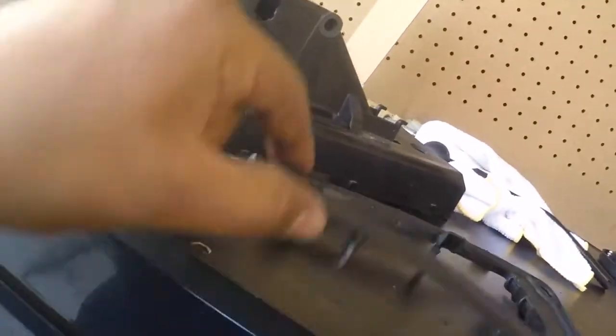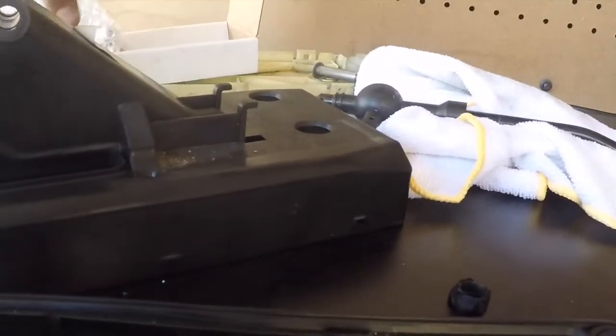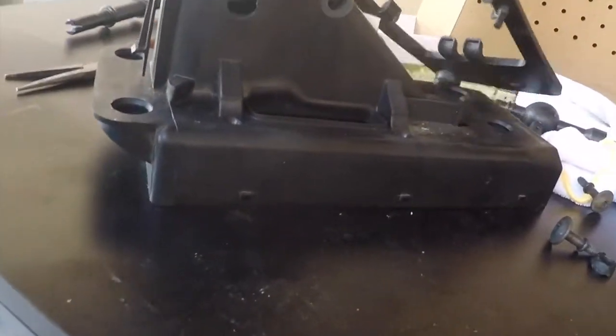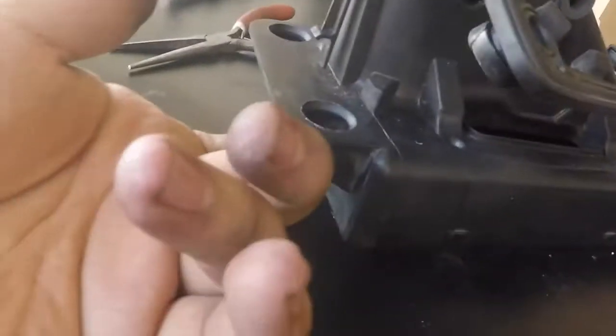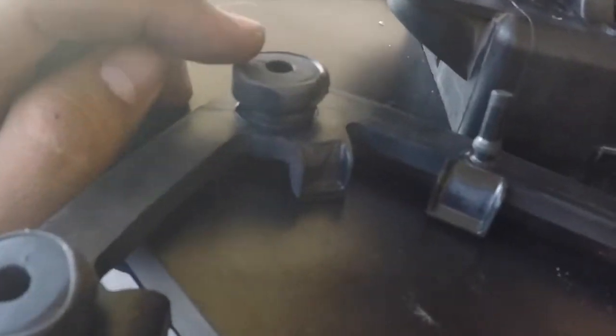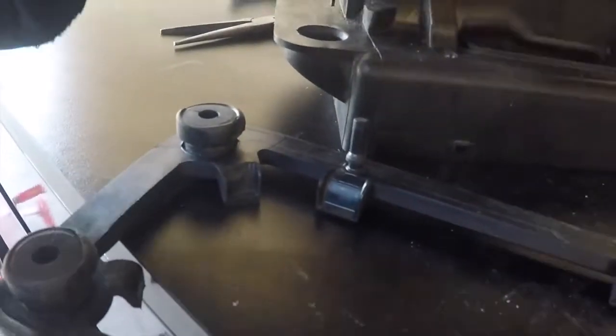This is also going to be an aluminum bushing install kit. Like I said, push the bolts out. You will be able to push these out. And then you should be able to pop this off by pulling it using a flathead screwdriver to push it through here to pop these ridges out. Now, from my understanding, this thing is kind of like an insulation, I guess you can say, to this box.